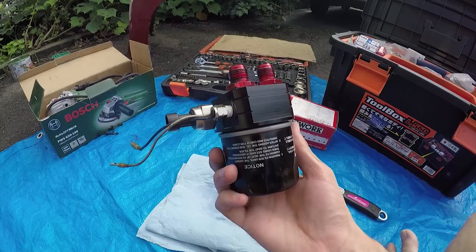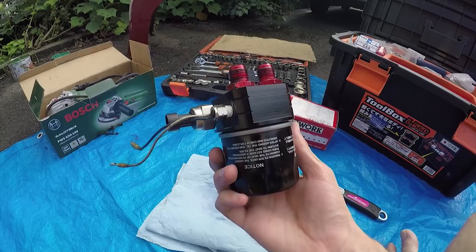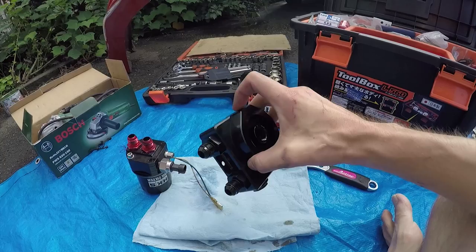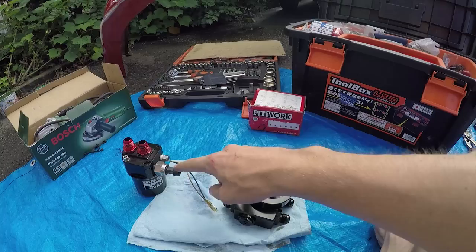So this is the oil filter block I just took out - a little bit tedious and a pain in the butt, but it's all good. What I'm going to do is take my sensors out of this and transfer them over to the new one. The top one is for oil pressure and the bottom one is for oil temp. We'll take those out with an Allen key, slip them into the new block, and hopefully the threads all match up.